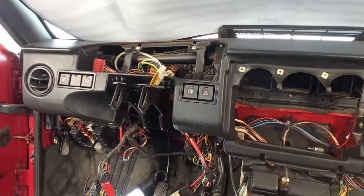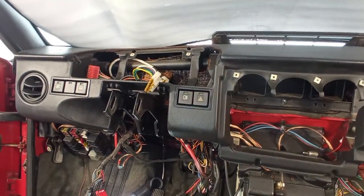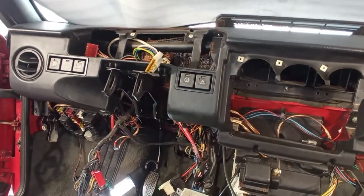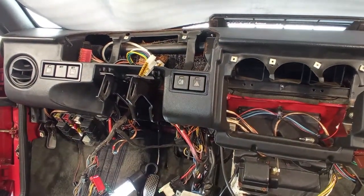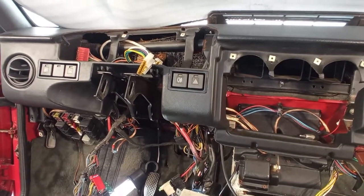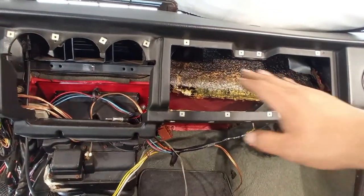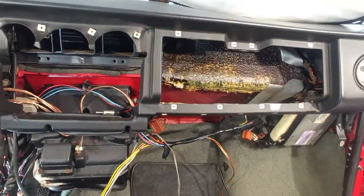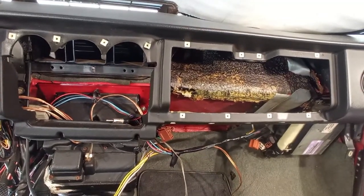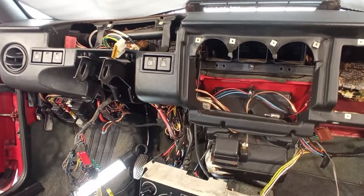I have to check somewhere else to put this in the original configuration. On my 75, the pictograms do not work, and I already saw that I have a common ground for lighting the pictograms. As far as I could see, I have a burnt wire. The wire goes to the common ground, and I do not know if that is the problem yet, because that dashboard seems to be a little more difficult to take out. But I have to remove it, because I will take care of the rust and all that stuff on the outside of the car, on the wiper area. And I want to have this inner area available for the body shop to take care of it, okay? So if you know any common issue on the 75 about that problem, tell me in the comments below, so we can exchange some ideas about that, okay?